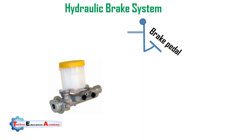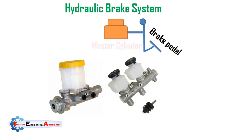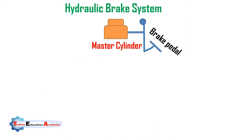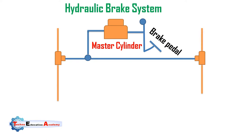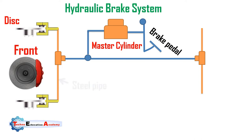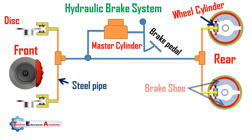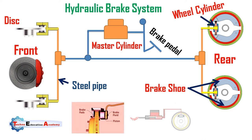The main components of the hydraulic brake system are master cylinder or tandem cylinder and wheel cylinder. Master cylinder contains a reservoir for the brake fluid, is operated by the brake pedal, and is connected to the wheel cylinder in each wheel through steel pipes, unions, and flexible pipes. The hydraulic brake system can be used with drum brake as well as disc brake. The system is designed so that even when the brakes are in the released position, a small pressure is maintained in the pipelines to ensure that the cups of the cylinder are kept expanded, preventing air from entering the cylinder.